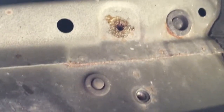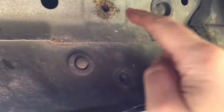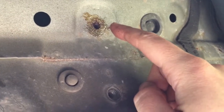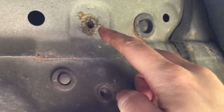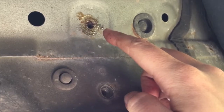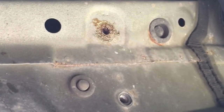Starting with the driver front mount — right by the driver's tire, there's the first hole. Because it's exposed to the elements, this hole had some rust in it, so I put a little grease in there and ran the original bolt in and out a few times to prime it. The other bolt holes further in shouldn't be a problem since they're not exposed to the elements. Now let's install this first bracket.